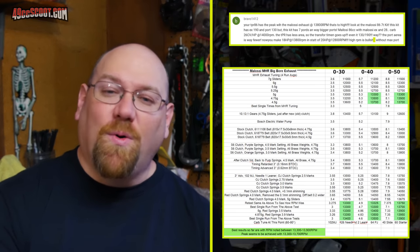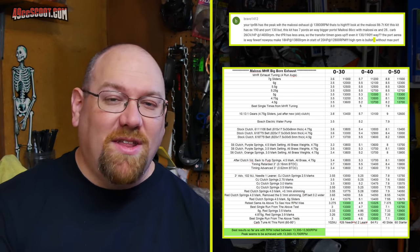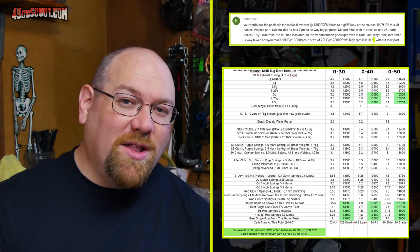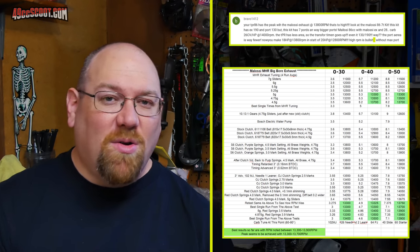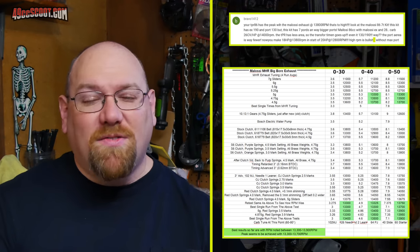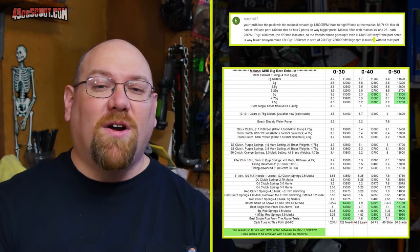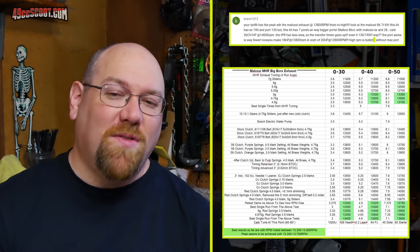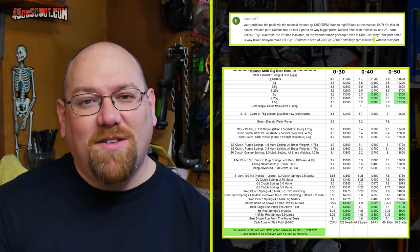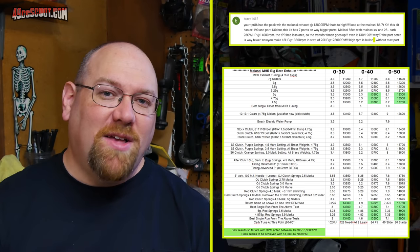I can do the same thing at 40 and 50 miles per hour and say, well, it looks like when I can keep it at about 13,500 RPM that I get to 40 miles per hour more quickly, or 50 miles per hour more quickly, or transition from 40 to 50 miles per hour more quickly. Whatever the case is, I can look through the data and see where the engine is working the best. So regardless of what anybody tells me about what works for them, what they say in any book or specification about TPR, etc., I can tell you in the real world what is actually working for my setup.